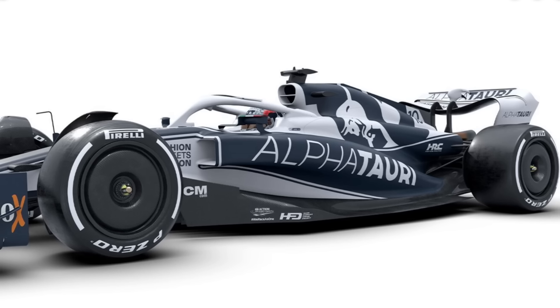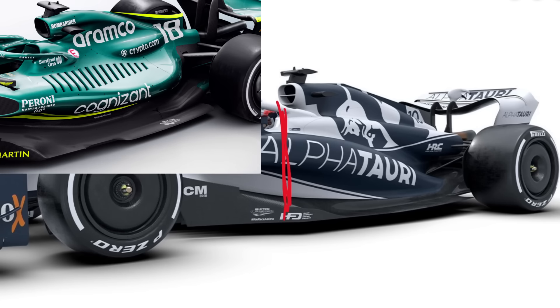As discussed, the Aston approach is likely to control losses on the top and pressurize this area a little bit. You can see from the top-down view how we have that squared off inlet at the front of legality and then the outwashing portion, with a smooth taper along there. However, once we get rearwards of about here, this is where the strategy really starts to diverge from the Aston approach.